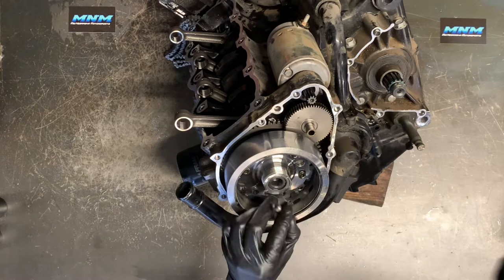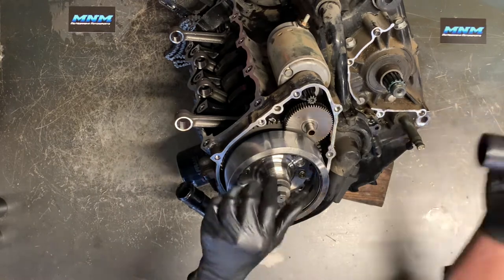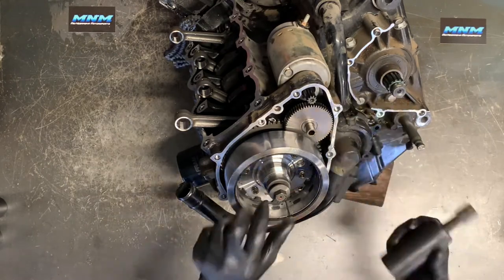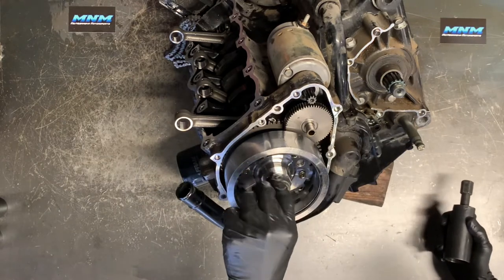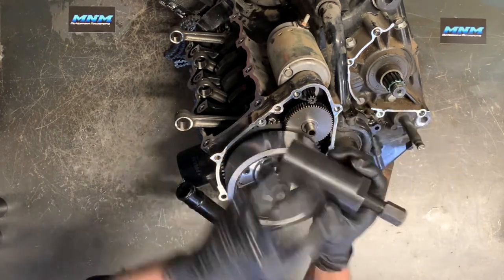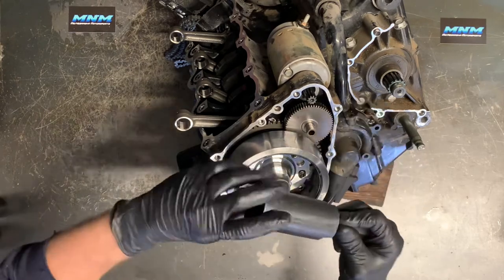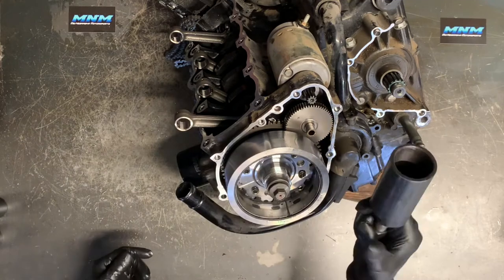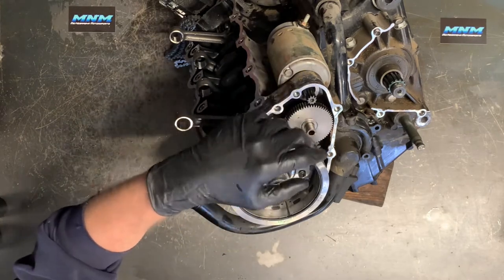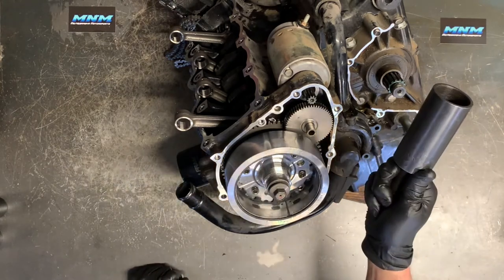I've got this bolt loosened and removed. I'm actually going to put it back down in there — I wanted to show you what it's like to pull that flywheel off. What you need is a special tool that looks just like this, and I'm going to offer you a chance to win this puller. We're going to spin that on, leave about a quarter inch of play, then grab our special puller. Make sure it's got the right thread pitch, enough length, and that this bolt is long enough. Make sure you've got a good high-quality steel puller — this flywheel is probably between five and six hundred dollars. You do not want to damage it by using a cheap tool.